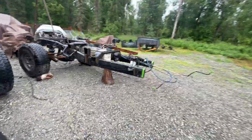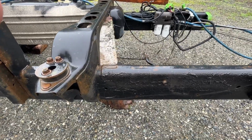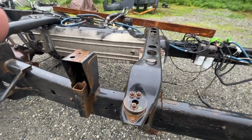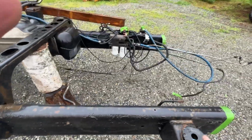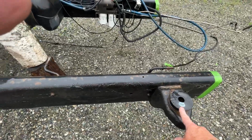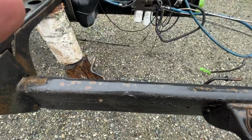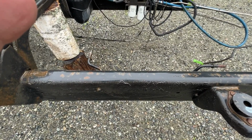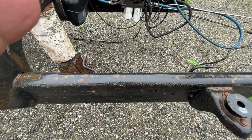Let's go over to the long big section of the frame that we're going to put in. So, measuring distances, just to make sure that your last body mount lines up with the next one on the other frame over here, about 26 inches. I'm going to go a little long just to make sure I don't have any issues, and I'll cut it down as needed. And I'll give you a final measurement once I get it fit in there.